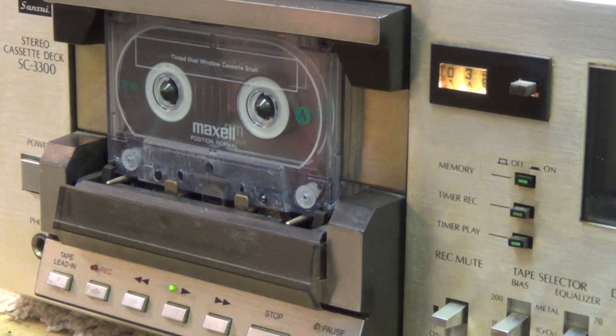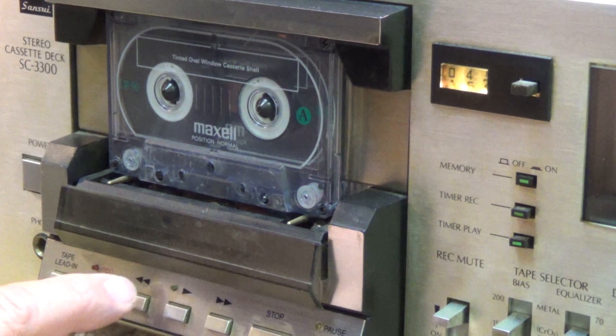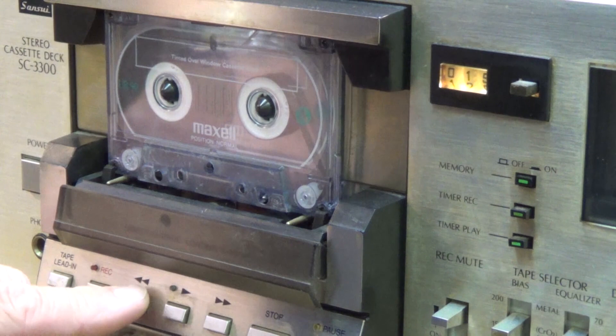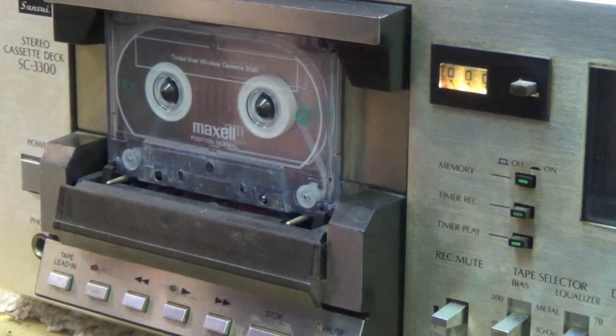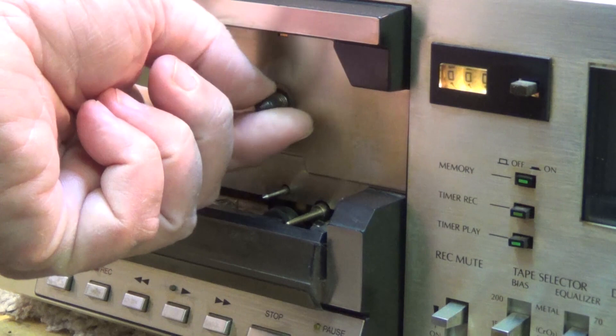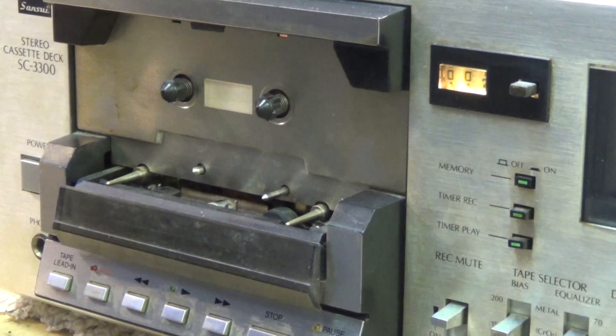This one here now appears to be working, but it wasn't working — it was stopping. And we have no rewind, or very slow rewind. We're going to have a rubber roller in this thing that's slipping, looks like. But the reason it was stopping was because the auto-stop mechanism on these units is operated by the tape counter. That's why I lowered the camera down so you can see it. When I first put this into play, the tape counter was not moving. It is driven by a belt off of the take-up spool, so if the take-up spool stops turning or that belt starts slipping, the auto-stop mechanism is triggered from the tape counter. I'll show you how it works.